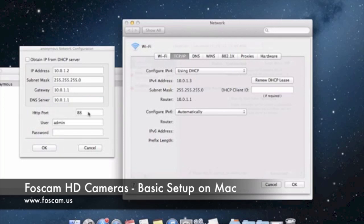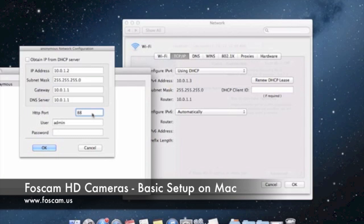The HTTP port is by default on the newer cameras set to 88. On the older cameras it used to be 80, which caused some router conflicts because your router is usually also at port 80 — so sometimes people wouldn't be able to connect to their camera because the router is on the same port. The port works similar to an IP address when using outside networks — it distinguishes each device on its own. Every port needs to be assigned separately to every device, just like IP addresses. By default the newer cameras use port 88. We do recommend changing it to something in four digits. You'll be using that later to port-forward your camera in your router, which we'll cover in one of the next videos.